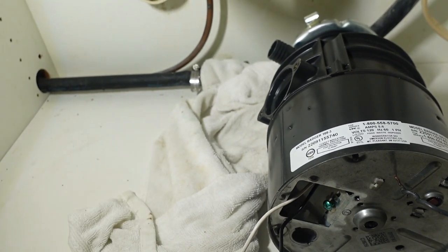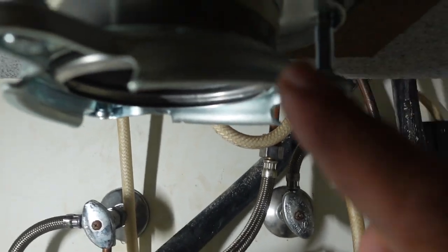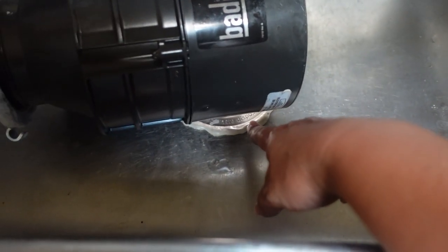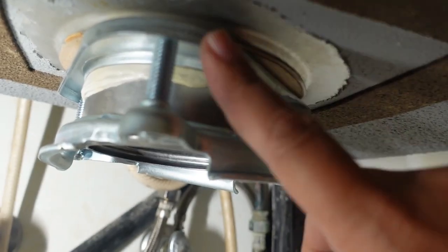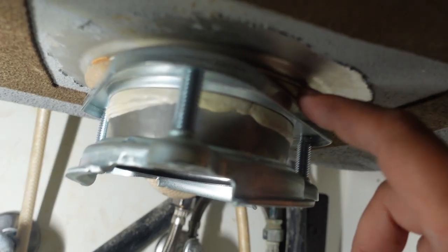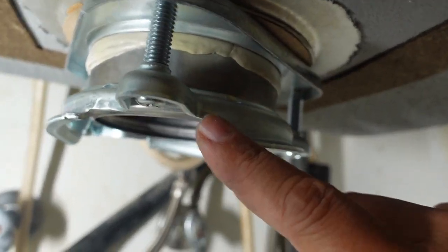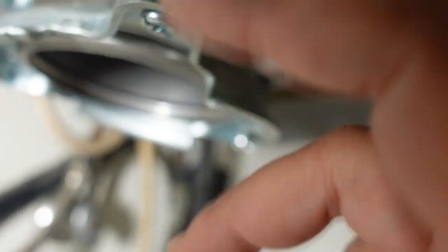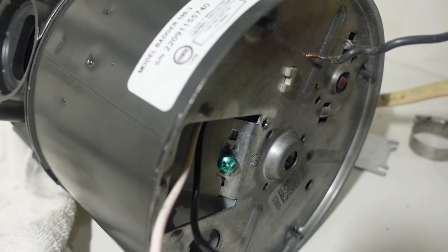My memory card erased again. Pretty much: put the old Insinkerator over it as a weight over the ring, then come back up and put everything in reverse the way we took it out. You have this cardboard ring, this piece, the screw - loosen the screws a little before you put it in. Then put that locking ring in - that's the hardest part, it's what keeps it all solid. Once the ring's in, use a flat head screwdriver to help. Screw these in tight but not too tight, just so it's solid - that's what's going to hold this up.